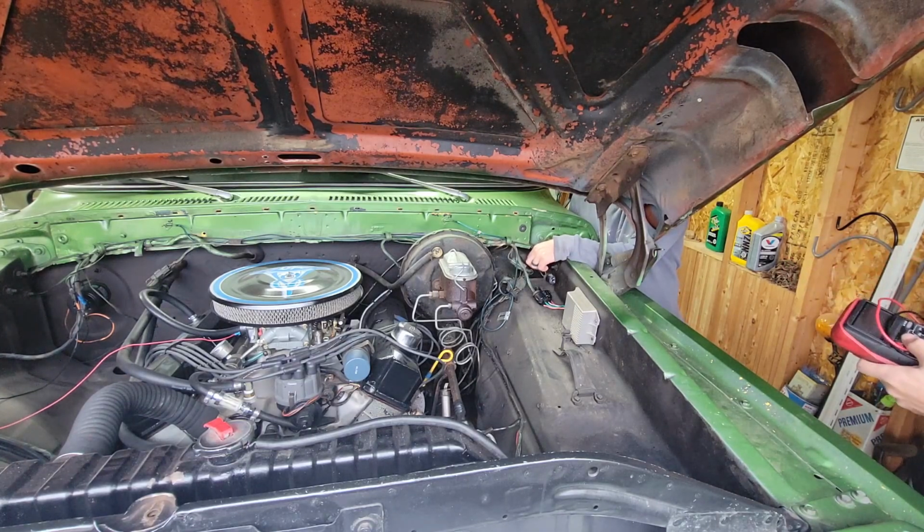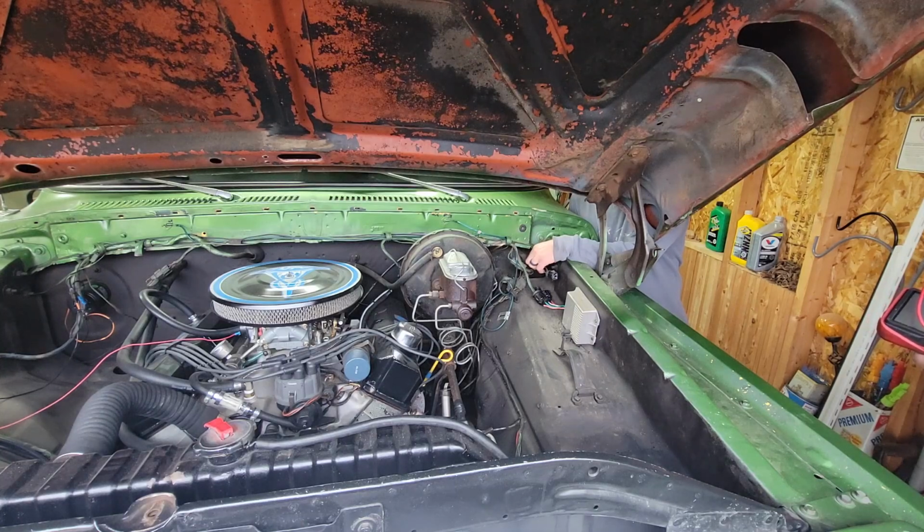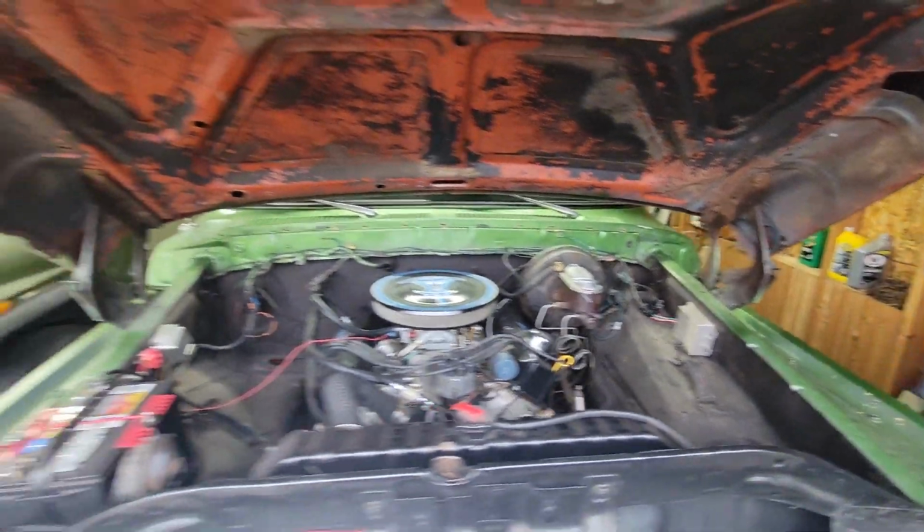But you've got to have a fuse underneath the dashboard for the radio. I do, but old trucks only had one. So you just wire those two together. Your memory is always on. Oh, wait, no, you wouldn't have memory. That wouldn't work. Right. But yeah, you have to find a constant hot. Correct. So if I find a constant hot, or have to run one, you could actually run a constant hot off the battery, run it straight to my radio, and then something's underneath there hot. Correct, right. You have to have a fuse tied underneath there. Yeah.